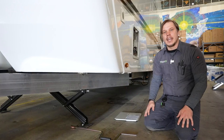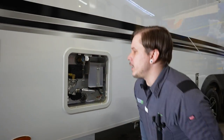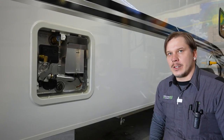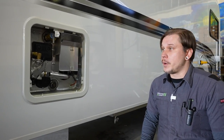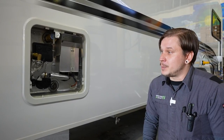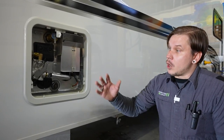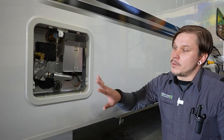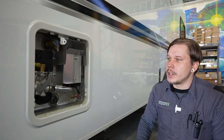Moving on, we have a six-gallon capacity dual-source water heater. It runs on 110-volt electricity at an RV park and also on propane gas with 12-volt direct spark ignition. The manufacturer recommends not leaving water in the unit for more than seven days, especially in the water heater. When draining, allow about eight hours for it to cool down to avoid injury.